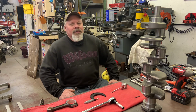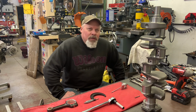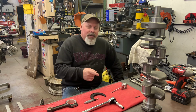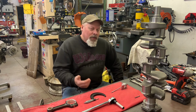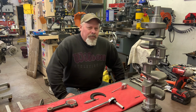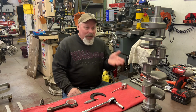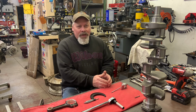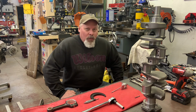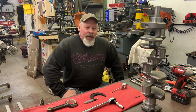The 377, that is. Yesterday morning early, I drilled the holes in the block and got out the plug that I couldn't get out. I got a little footage of that, and last night I was out here touching up the paint on the 377 block. I've decided to use the 2-bolt block as originally intended, and I also painted the 4-bolt block. I stepped away from the hypereutectic piston and forged piston situation and just started measuring the bore itself, and there's like 4 or 5 ten-thousandths difference between the bores, so pretty much I could pick either one. I'm going back to the original plan. So the 377 is going in the 2-bolt block as intended.